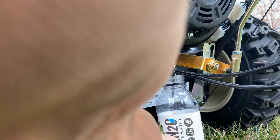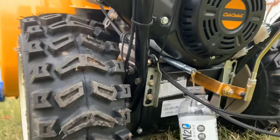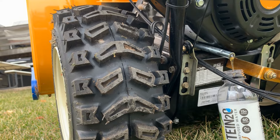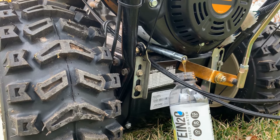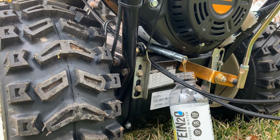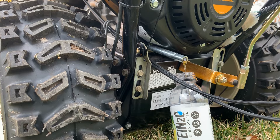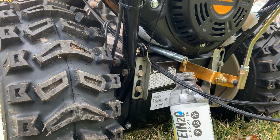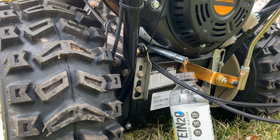I like to tilt it back just a little bit to make it come out just a little faster. We're just going to wait a minute to give it a chance to drain. This is one of the only maintenance items that are just absolutely required for your snowblower — to have that oil be fresh, because it sat all spring, all summer, all fall. Any gunk that is inside has already gone to the bottom, and it's just vital to your engine to have the oil replaced.